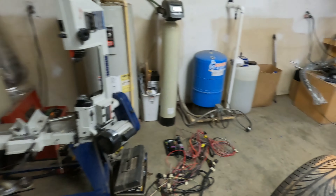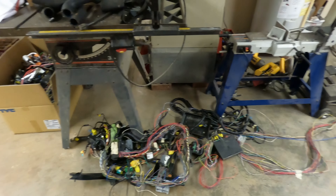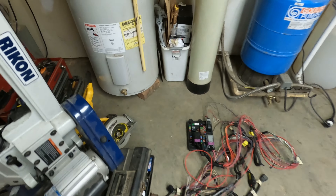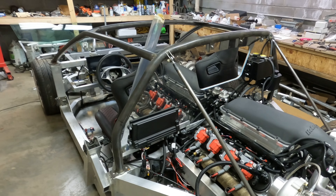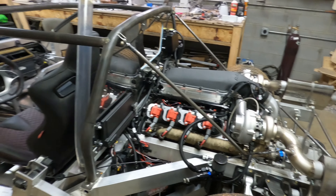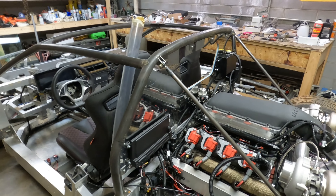Back to the wiring. What I've ordered is a device called a PMU — a power management unit. I looked at custom ordering two fuse boxes with just the fuses and relays I need, since I only need about half or two thirds of what is existing in this factory car, but those were going to be around 800 to a thousand dollars. The PMU is basically the same concept but it replaces the relays and fuses with solid state switches. The device itself is small, it'll mount here easily, and it has 16 built-in circuits.